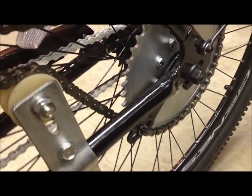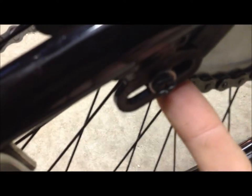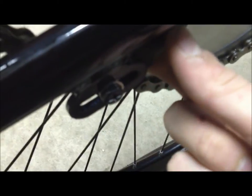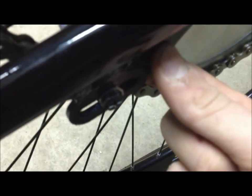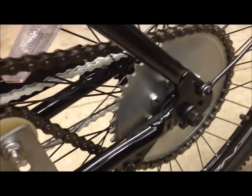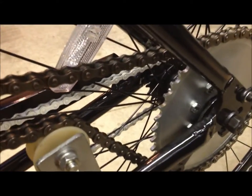With this coaster brake, what you're gonna want to do is put two bends in it. If you don't, it's gonna hit — you can even see how close it is to my bolts — it's gonna hit on those bolts on any bike with a coaster brake. So what you're gonna have to do is put the back end in a vise and bend the bigger body part. Then once you have a little bit of a bend in that, clamp the other part that hooks in down here in the vise, put a C-clamp on right down here by the vise, and bend it the other direction. You want the C-clamp as close to the vise as possible so it bends right at the point where the vise is clamping, so you can be real accurate with your bends. It takes some bending back and forth — it's not completely straightforward.